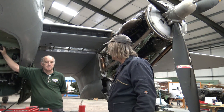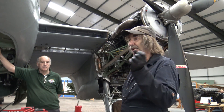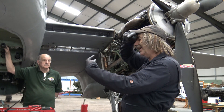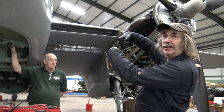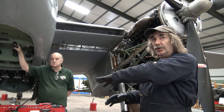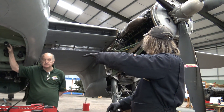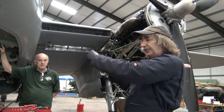There is a difference between the two sparks — it's not much but it's there. It's because of the location of the spark plugs in the cylinder head: they're on opposite sides. Because of the gas flow across the engine when it's running, you've got the inlet spark plugs next to the inlet valves and the exhaust spark plugs next to the exhaust valves, but the gas comes in one way and goes out the other. There's also valve overlap where both sets of valves are open together — this scavenges the cylinder to pull out the burnt gases and expel them through the exhaust, which is why the exhaust system design is so important.